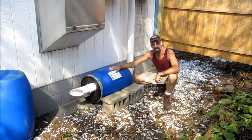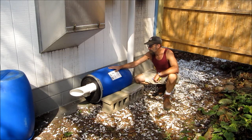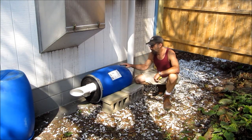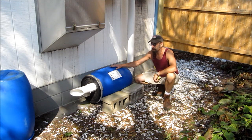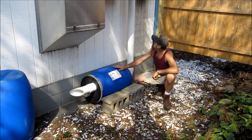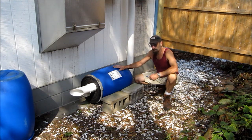I think that's recycling at its best right there. We've got this plastic barrel that once the lobstermen get done using all the bait up in the container, they're pretty well sitting around. Made a great muffler. Really happy with the tone — I was able to quiet this thing down. Rushing air is the only noise you have now; the turbo wind is completely eliminated. We can pop it apart, change it, modify it and do whatever we want. We have another barrel ready to set up, so we're confident with our noise control now, and that was the only pollution we foresaw with this system.